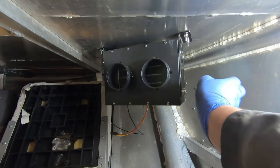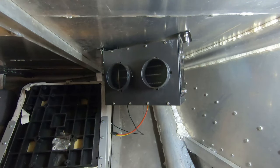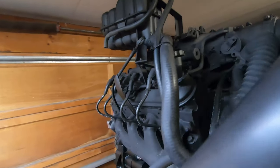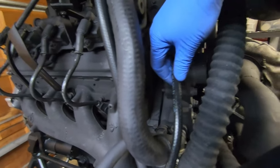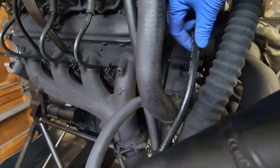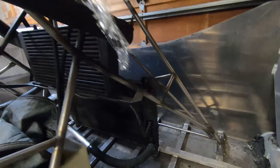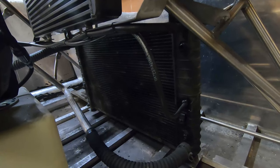The heater is fully mounted — it looks good and it's nice and rigid. Now I just have to run the heater hoses and the wiring. I have this steam port connected; for that I used a quarter-inch fuel line because I wanted something pretty durable. It's probably overkill, but I was worried that a regular vacuum line-type hose wouldn't be able to handle the heat. That line runs all the way down and the radiator is completely hooked up.